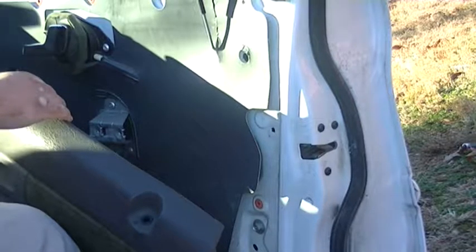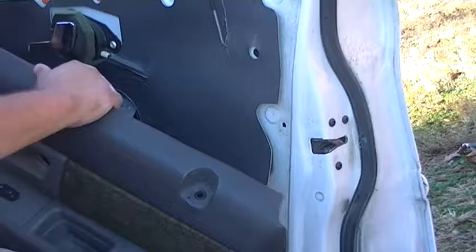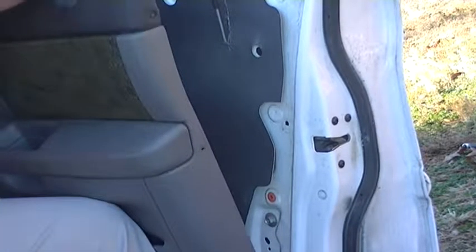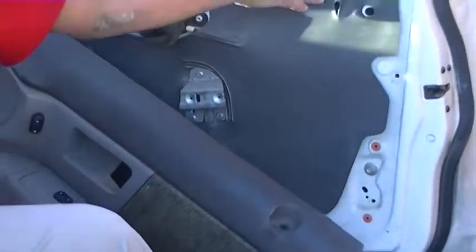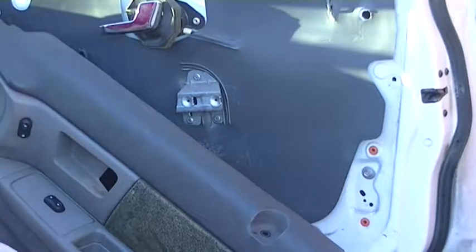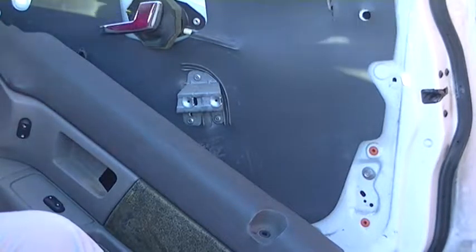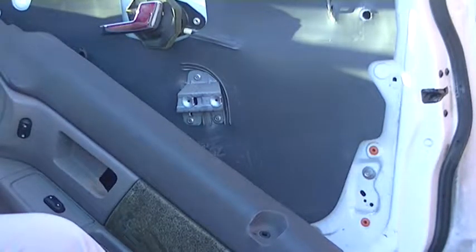Alrighty. After rolling the window back down, let's unplug our wires off of our switches. Better yet, you can just let it dangle. Well, I really recommend dangling it though. Okay, it'll be okay to dangle for the short period of time I have to. Then let's find our 6mm socket, put it on our ratchet. And that screw is already loose.